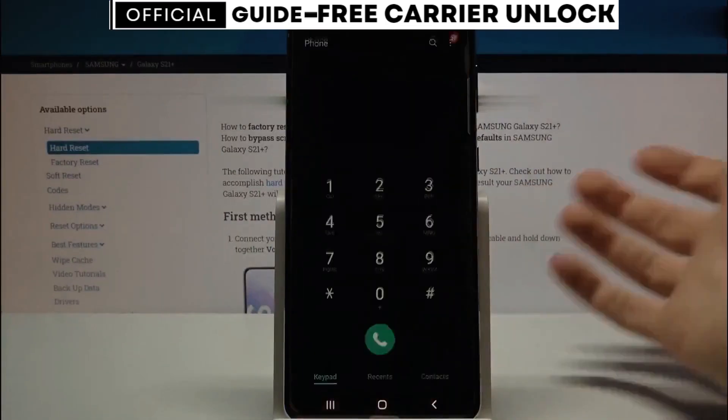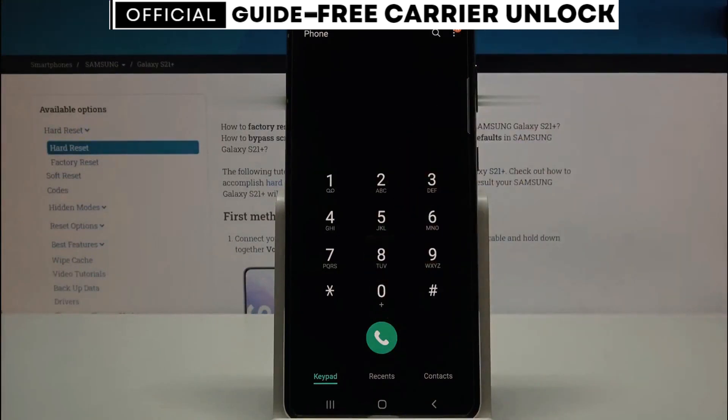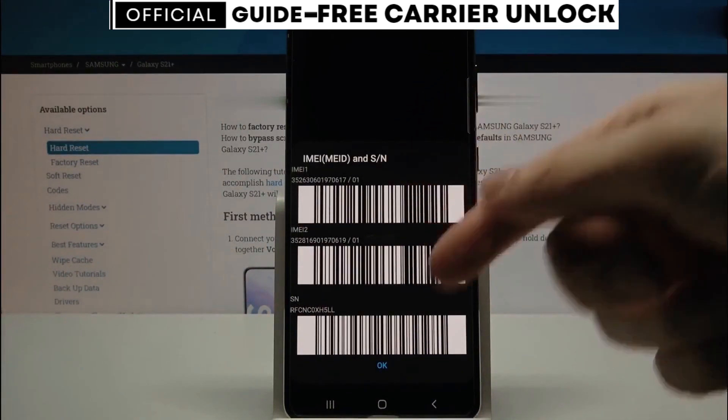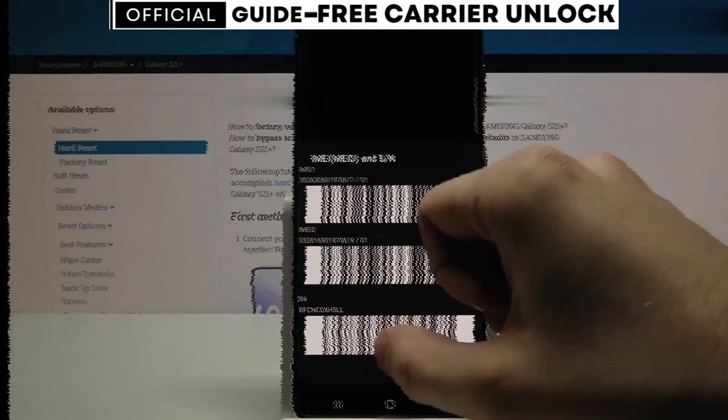To start, we're going to get the phone's IMEI number — that's a unique number for every phone. To get it, simply dial *#06#. As you will see, your 15-digit IMEI number will appear on the screen of your phone. This number is very important; it represents the ID of your phone. Keep it somewhere close because we're going to use it in a few seconds to unlock this phone.